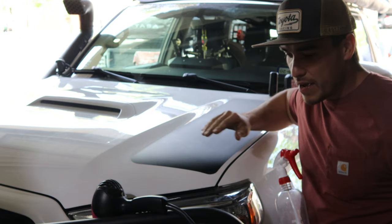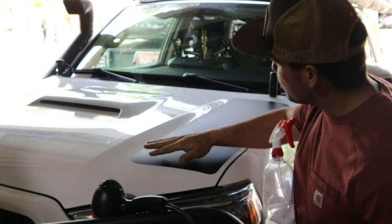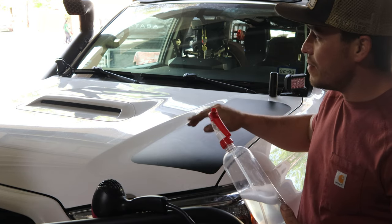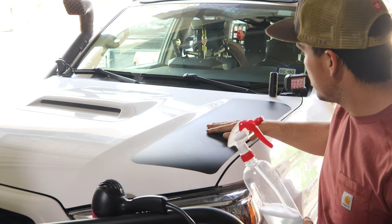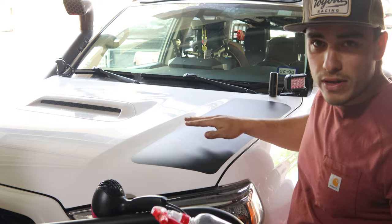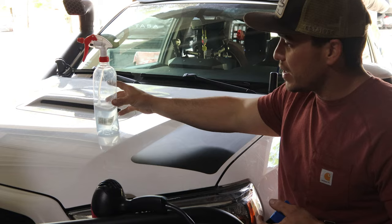I got the second side on and I made some changes on how I put it on. We found out that you can spray these with soap and water — just regular dish soap and water. You spray the hood and then you spray it underneath the vinyl as well, and it makes it so much easier to put on without getting air bubbles. The first side I did not spray with soap and water and I had to squeegee out probably 50 air bubbles. With this one we used soap and water. All you do is spray it, spray the bottom of the vinyl, lay it down, and that gets rid of all the air bubbles — it makes it easier to position and easier to work with. I'm going to get started on the hood section and show you guys how we're doing it.